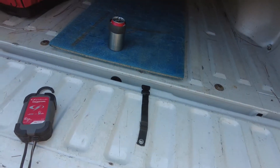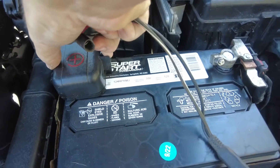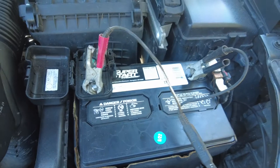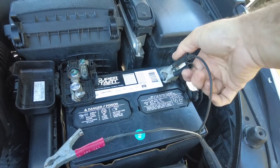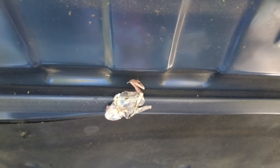With the Hyundai you can't go wrong — the positive terminal has a big red plus on it. Normally I hook up the negative side first and then the positive side, then let it charge. Like I said, I did that for a day, came out, started it up, took it to town, and then a couple days later it was dead again. So now you know how to use the charger — positive to positive, negative to negative, and let it go.